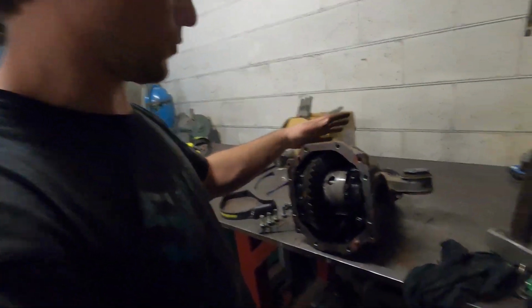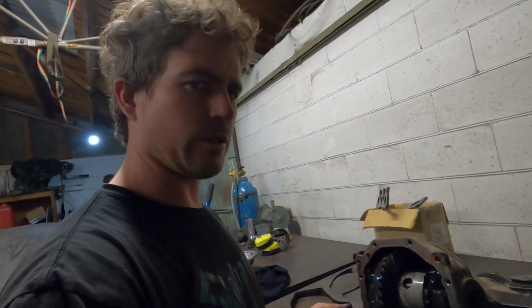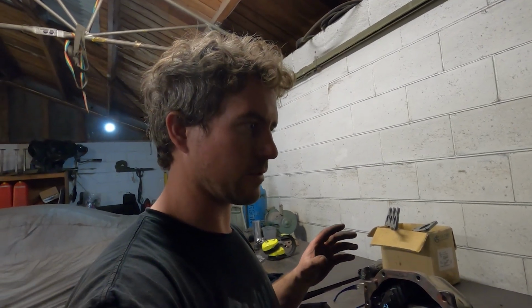So obviously they are a Toyota Subaru collaboration, and so they've got a mix match of parts of both Toyota and Subaru, mostly Subaru, but the diff, fortunately for us, is very much a Toyota. This is a G series diff, and it has the same size crown wheel as many Hiluxes, Supras, Altezas and Chasers and many other things.